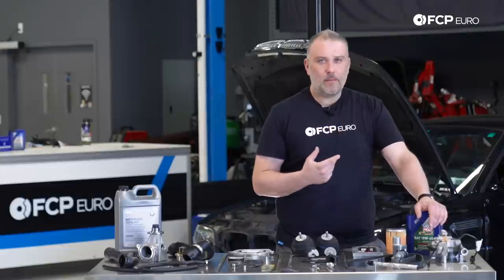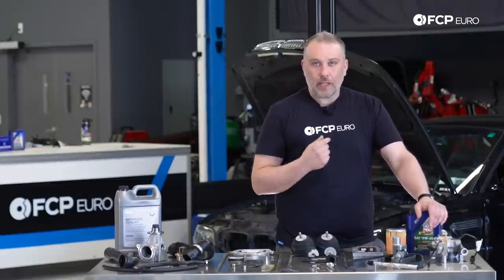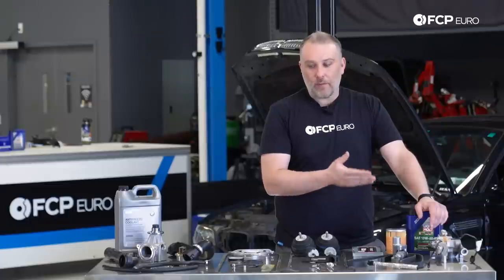When it comes to the oil pump nut, if you want to safety wire it or weld it as a precautionary thing, you can. However, from what I've seen, I've never seen an S54 lose its oil pump nut and therefore lose oil pressure, causing catastrophic engine failure. That's really more of a non-S54, Euro S50 thing.